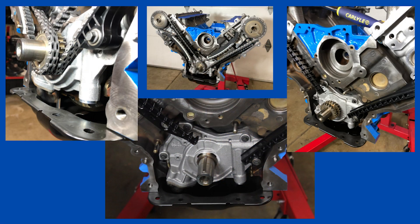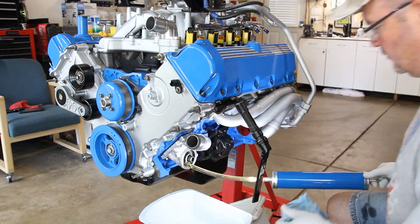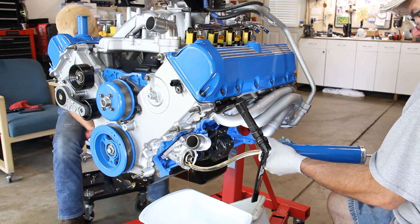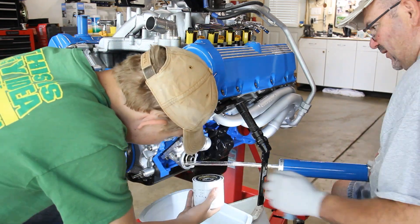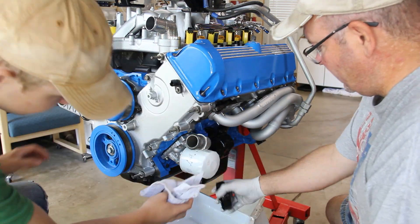Here are a few pictures of what our oil pump looked like as we started putting the motor back together — our oil pump is installed. You'll also notice that we got that fourth fastener installed where the timing chain guide goes down onto the oil pump. Once that was done, it was time to prime the pump once the motor was back together. I used a suction tool — a new clean one — to inject oil down through where the oil filter is mounted. We also filled up the oil filter and mounted it on the housing, and then we were good to go.